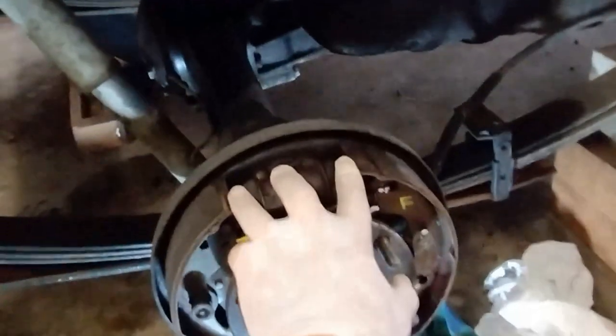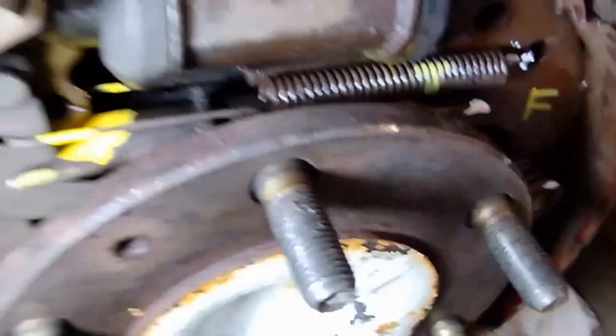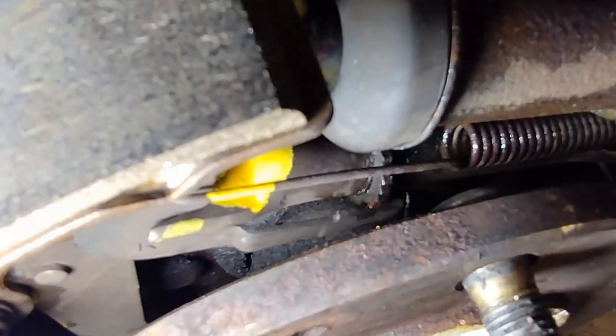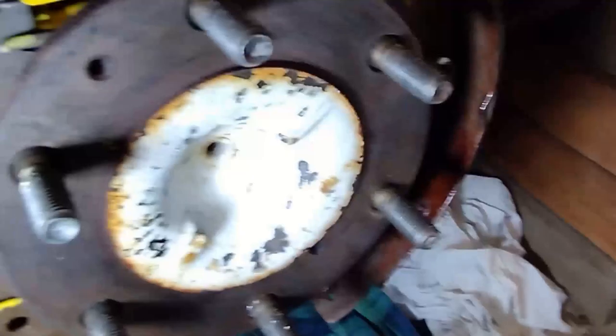That's these spread out when you put your foot on the brake. That makes the shoes spread out and stop. These two pins here keep the shoes in place. We've got an adjuster arm going from there to there, and that's got that cog in there. There's a cog in there, and there we can see there's an arm going down there and across to the inside that turns that sprocket looking thing and tightens the shoes up to the required tension. So that's pretty well it.